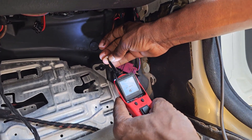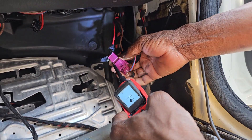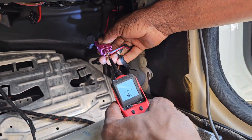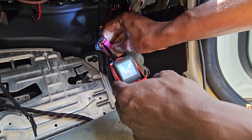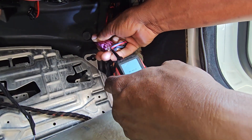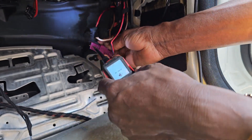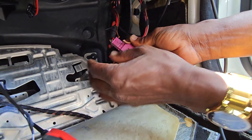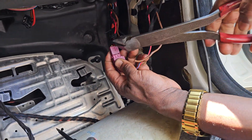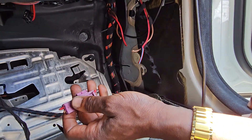See — now everything is gone. I don't see nothing now here. Before, this thing melted here. You see the short is here. If I get here — you see? There's a wire that's going to be — it's not right now. I checked it out. Now there is nothing. But when I move it, they melt and touch each other. In this place here, even the fuse blew. This is the main fuse. So now we don't have no problem. The whole problem is that this connector here became hot and melted.